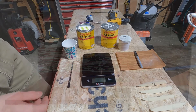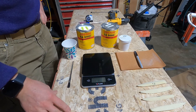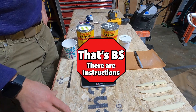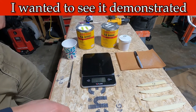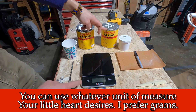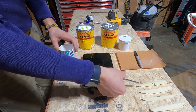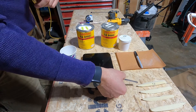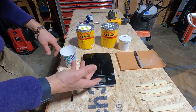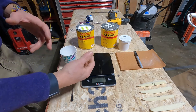We're going to mix up a little Hysol. I watched a video by Spector Fox and was thankful he had done it because there really were no instructions. For the Hysol 9460 you need one part of each, weighed out — I usually use grams. You need a cup, and today since I'm attaching end caps for my horizontal stabilizer, I'm going to use a small brush to apply it, though some people use syringes or a baggie with the corner cut off squeezed like a pastry bag.